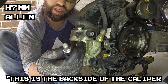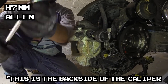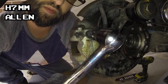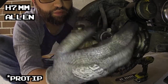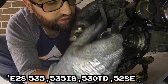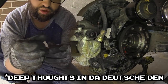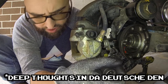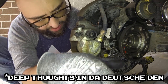This is an H7 — they've written V on this but it's a 7, as far as the size. I've just got a half-inch adapter because mine are 3/8s. You want to seat it as snugly as you possibly can in there, and then we're going to be pushing down in this instance. Pro tip: these rear calipers off of the BMW M5 are the same exact caliper as the 535i and 535is. The bolt pattern for the carrier is apparently the same as an E34. In the event you're going to put E34 — some people want to upgrade — you could do it if you're absolutely adamant that you need vented rotors in the back, but the other side of the coin is you're adding weight. So the E34 rear calipers, any of them will fit.